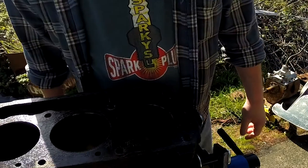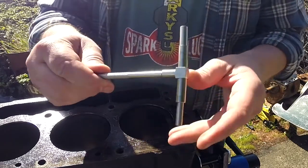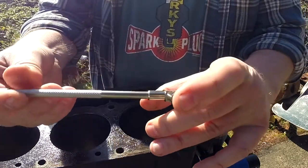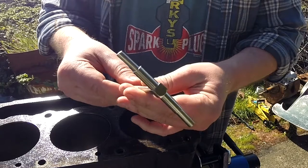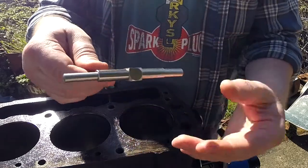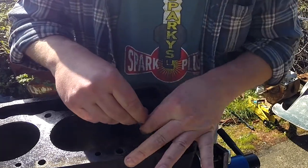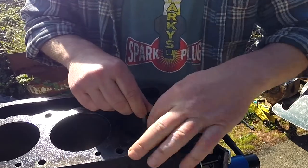I'm focusing on cylinder number six for some of the measurements. I bought this on the weekend — it's a telescoping inside bore gauge. Once you've measured it you can tighten up the end and it should stay. Regrettably this bore is kind of getting close to the outside range of what this can measure, but it is within range. The next size up is too long to fit down here, so I've been taking measurements further down because with the other machine I was only able to measure the ridge.